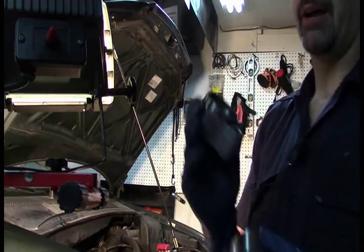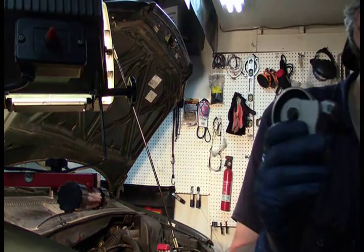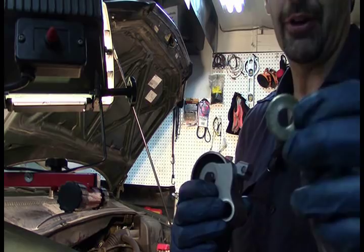This particular idler pulley is the one where the timing belt tensioner pushes up to create the tension. You may miss this, but there is a washer behind this one. If you miss that washer it's still stuck to the timing cover and it may fall off at any time. Make sure you have your washer for this one — it's easy to miss.